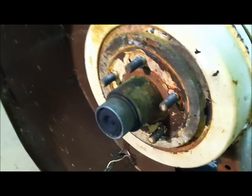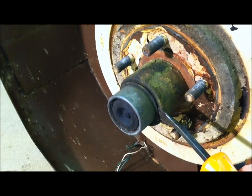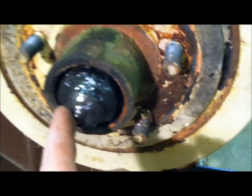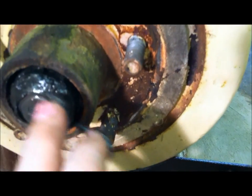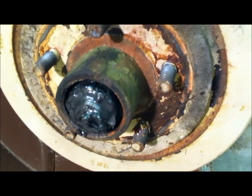I still never bought a camera stand, so this is going to be shaky. This is your dust cap — it's the first thing you're going to take off. Just get a chisel, pry bar, something in there and pry it — it'll come right off. It's full of grease like it's supposed to be. My hubs are a little different; mine actually have grease fittings in them. Most don't — you've got to pull these out and pack them. I can just take that little plug out of the end cap and throw some grease in.